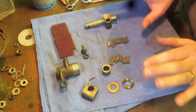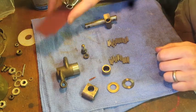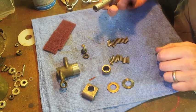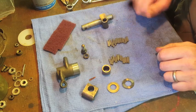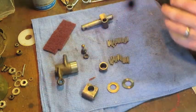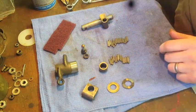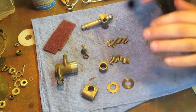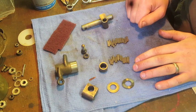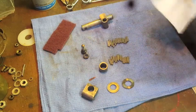I've disassembled this already. I've gone through and used my scouring pad and some WD-40 to clean off old pressed-on gunk, and that's gone through every single component. You can see an old one I haven't done yet — just dirty oil, nothing too crazy. I wanted to walk through some of the ways we evaluate different aspects of the rocker and either repair or replace them.